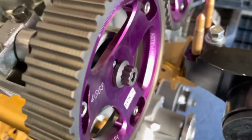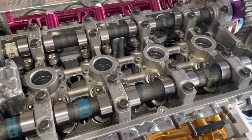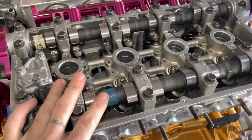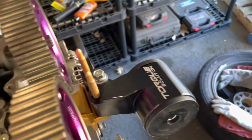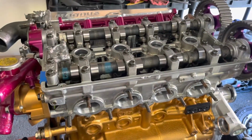And I didn't know if they'd rock at all. I didn't want them to touch the valves. This is an interference motor, so I didn't want to kiss the valves, even just torquing that down. So other than that, I'm going to get all that stuff on and then be ready to torque the head. And then I got a couple other little things to get, and then I'll throw the timing belt on. Once I get the timing belt on, that'll probably be the next video.